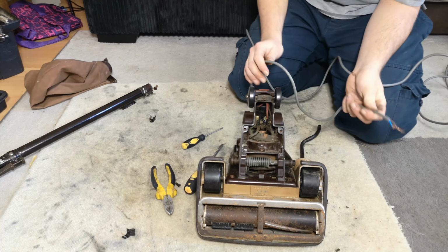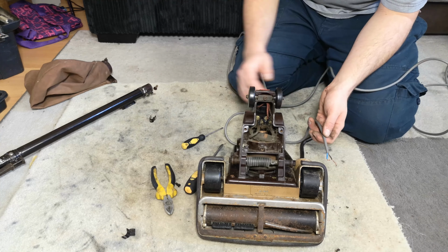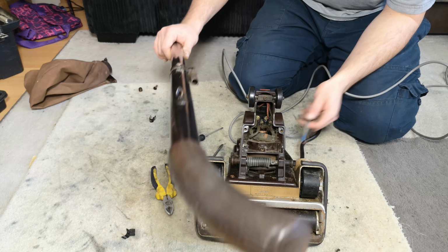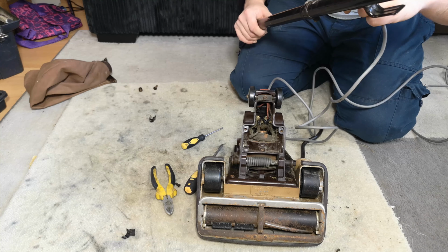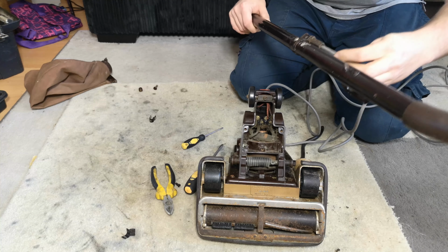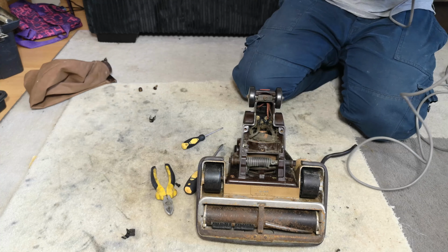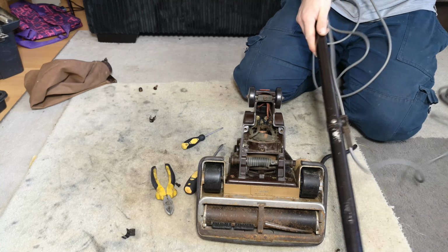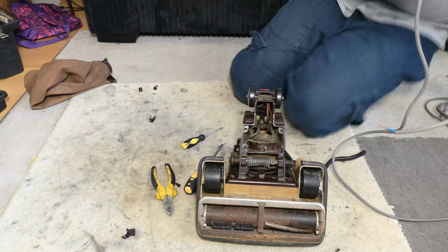So pretend that you've gone and got yourself some lovely brown flex from the internet to match it, you know, a good 9 metres, so it's long. And we actually need the handle back, because we've got to push this through, and I'll fit it properly to show you, even though it's not staying. Push it through this top piece here and pull a lot through, so you can put it to one side and have enough to work on.